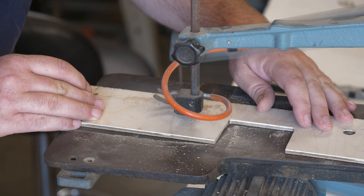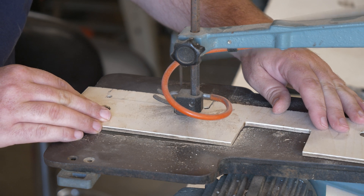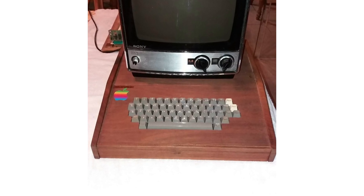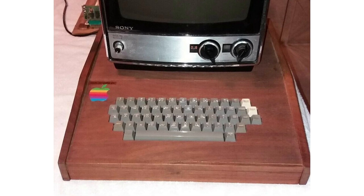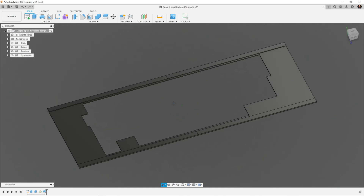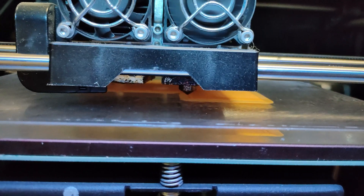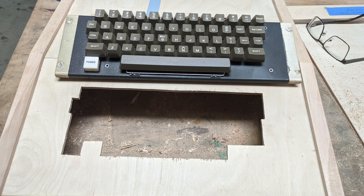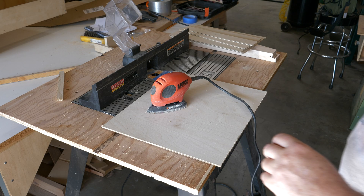Armed with that information, I was able to use a scroll saw to cut out the places where I needed the airflow to be, as well as to cut out some spaces for power and other components on the back panel. Cutting out the keyboard turned out to be an interesting challenge — to cut around each of the irregular shapes of the keys you have to be really careful and very precise. So I turned again to Fusion 360, where I created a 3D template of the hole that I would need to cut out for the keyboard. Then I printed it out on a 3D printer, carefully traced around, and cut out the opening with a jigsaw. I'll leave links to these documents in the description below, but keep in mind this will only work with this particular Apple II keyboard.